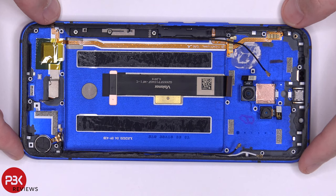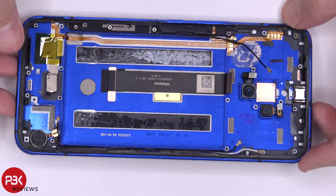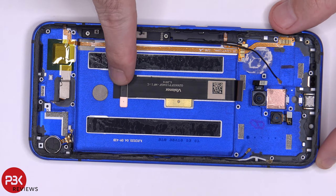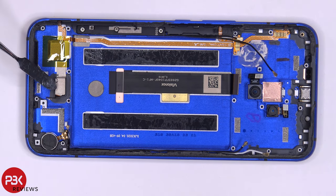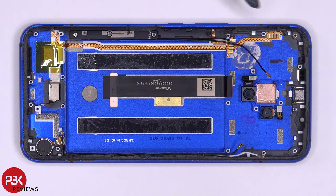At this point you're left with the mid-frame. You've got your screen attached to the mid-frame, and the cable for your screen is right here, run through the slit. If you ever have to replace your screen, just heat up the front of the phone, pry the screen off after disassembly, get your new screen, reapply it, and run the cable back through the slit. You have your vibrator motor in the bottom corner, your fingerprint reader held on with adhesive, a 5G antenna, the flex cable for the power button and volume key, and a long flex cable for the touch keys on the corners.